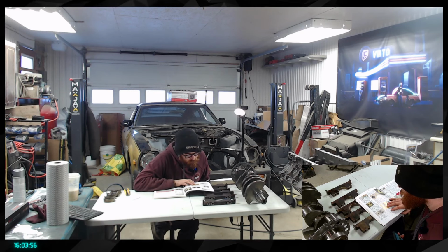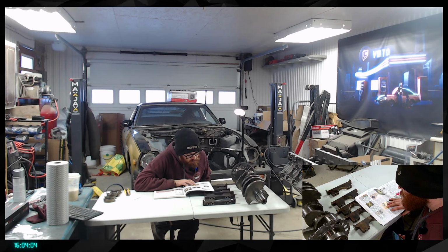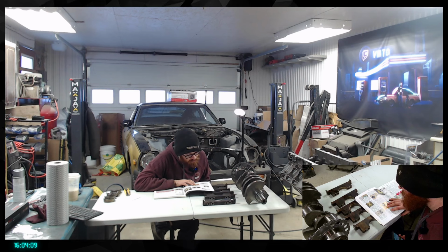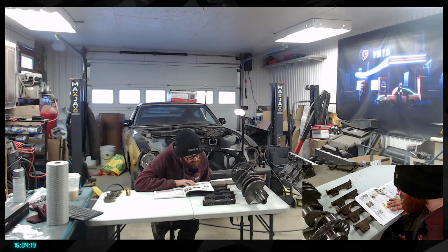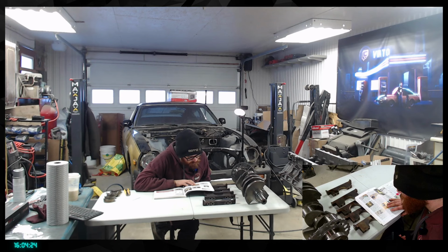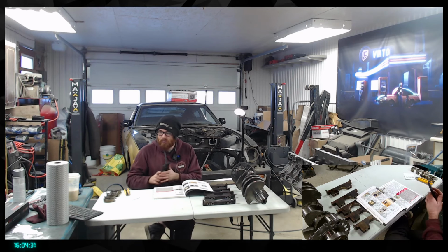In order to ensure your valve spring will be at the correct install height and thereby provide the right amount of seat pressure, you will need a valve spring height gauge. While primarily used during a high performance rebuild, this item can be useful in a stock rebuild too. You will need one that will work in the range of your valve spring required install height and will fit the diameter of your valve spring retainers. So you should probably hold off on buying this gauge until you have those items.